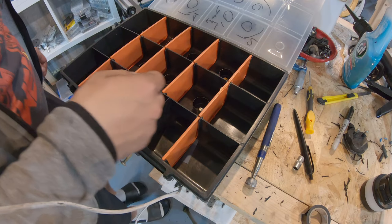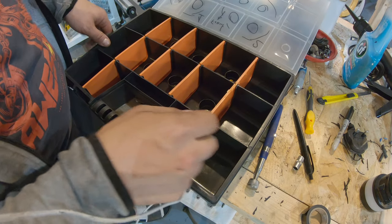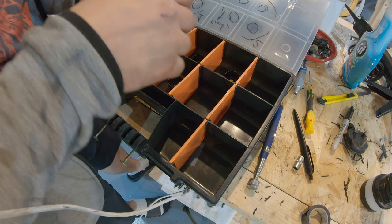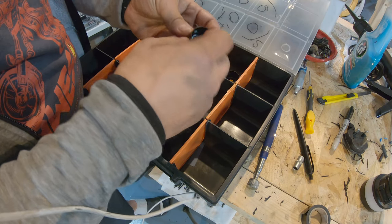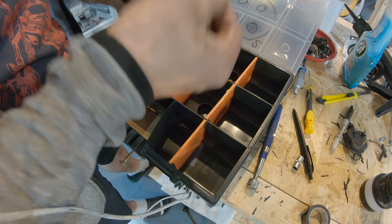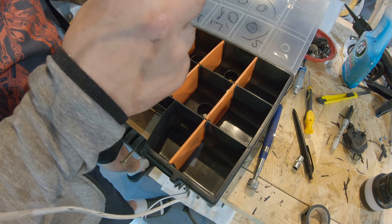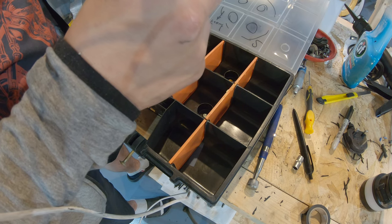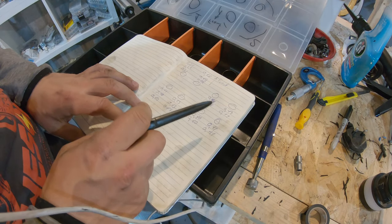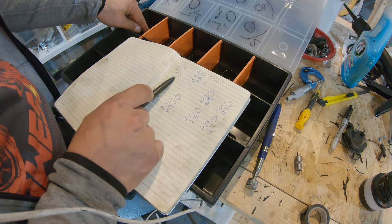Okay, so we have them all in here. The pads, they actually were sticking against the lifters, of course. So don't take them out and start to mess around with it. Play with one at a time so you always know where you have to put it back. The pad is inside here. And here we go. So this is a 205, for instance, which means that this is 2.05 millimeter thick. So we have here our book, our notes, and let's just start from this one, top.